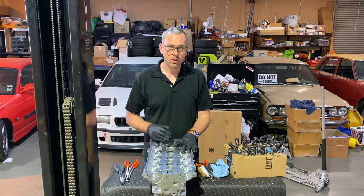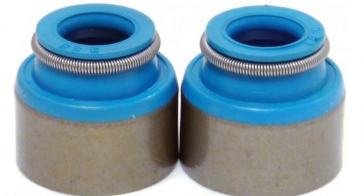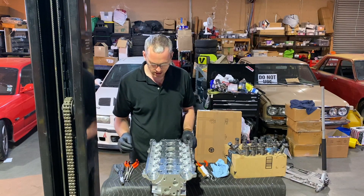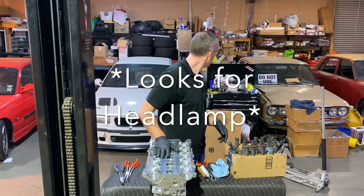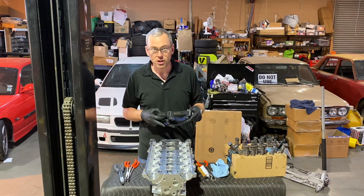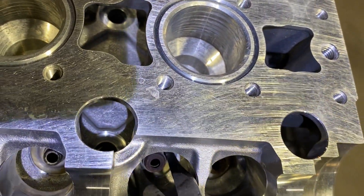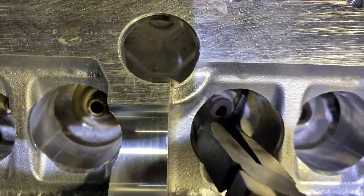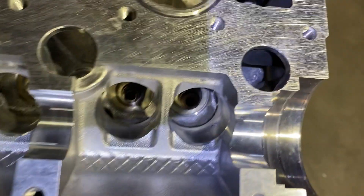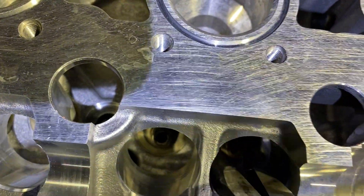What I'm going to do now is remove all the valve stem seals from this head. These little valve stem seals sit on top of the valve and essentially stop any oil from entering into the combustion chamber. They're held in with just a little bit of friction and can take a little bit of force to get out. I got my headlamp ready so I can actually see what I'm doing. I'll try these pliers first to kind of get in there — once you get them to twist around once or twice, you can work them loose.